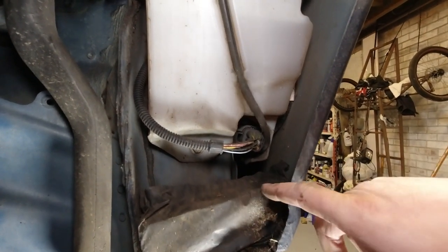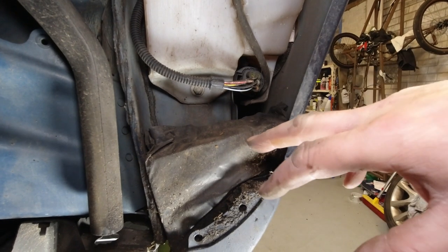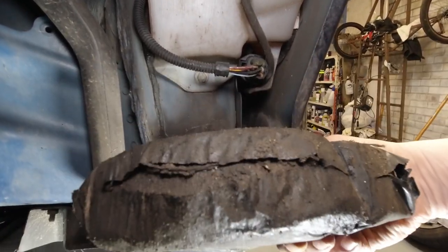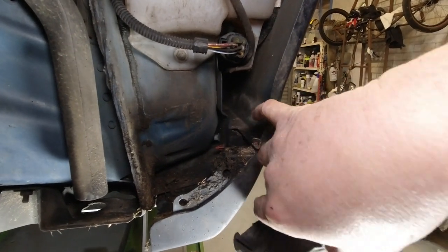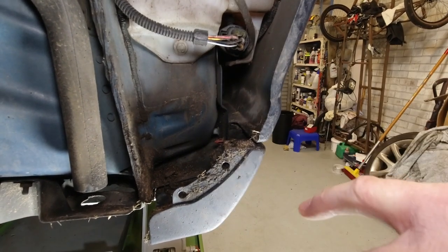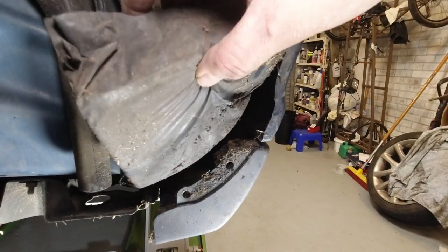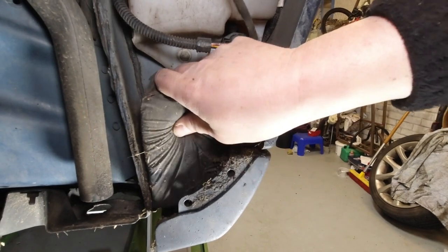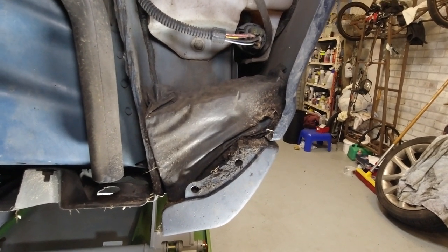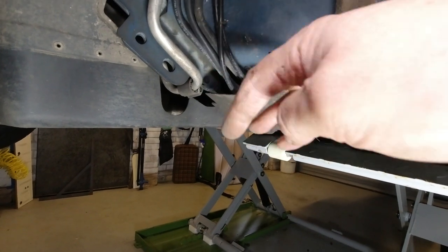And this is a sound deadening bag. And on these cars and the X351, there's a lot of these sorts of things in various places. I'll just take it out for you. Literally, a plastic bag with a sound deadening foam in it. And the reason for this is there's a lot of open hollow channels in the aluminium constructed cars. And you get sound that booms along them and can cause road noise. Big increases in road noise because of the sort of pipe organ type construction of some of the sections in the car. So if you find little bags like that, they do need to be there. Otherwise your road noise will go up massively. Here you can see a little deflector that basically stops anything getting near any of the pipe work.